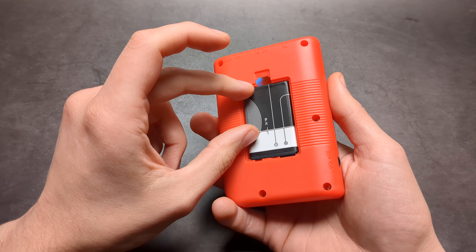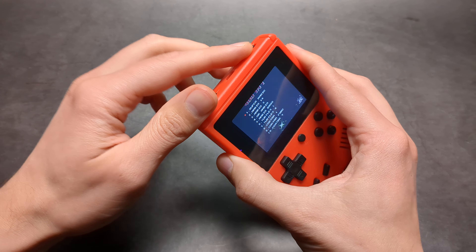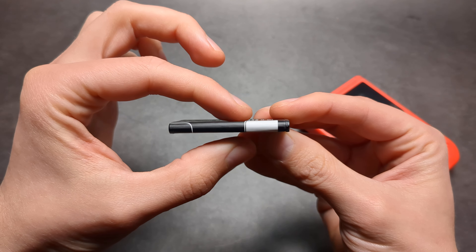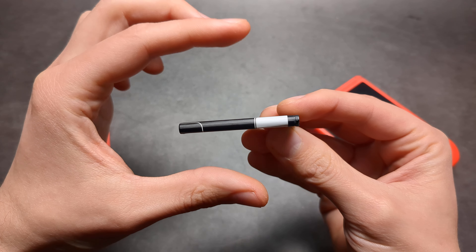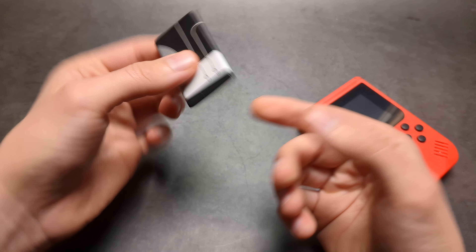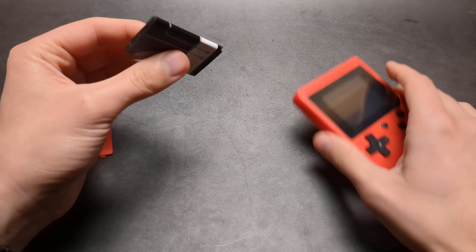Also, if this battery is very old, maybe it has been sitting somewhere for some time, you can take it out and check if it has expanded — become very thick. That means it has simply degraded and it's actually not safe. You should definitely throw it out and get a new battery.